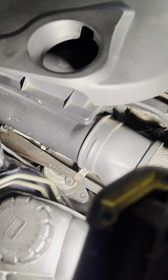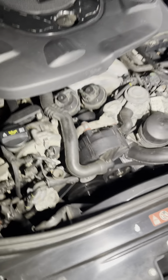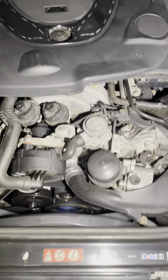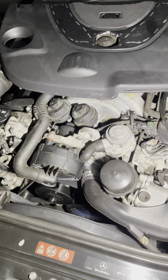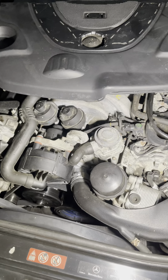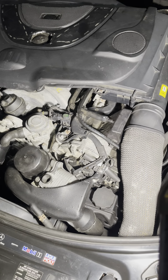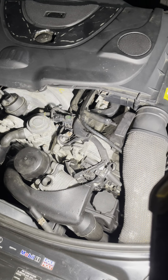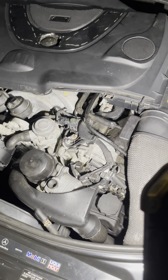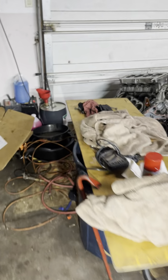As you can see, new mounts. This engine ended up being a good engine - I was worried about it because the book says you can go 10,000 miles between oil changes, and that's just ridiculous in my opinion. Once that oil breaks down or collects dirt, the lubrication just isn't the same, and that kind of stuff happens - like the cylinder scoring on my old engine.